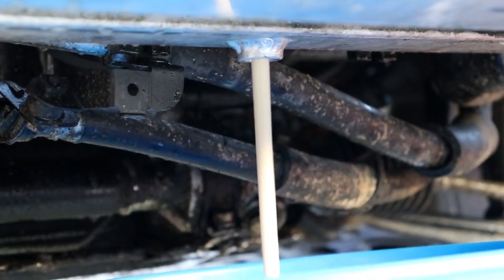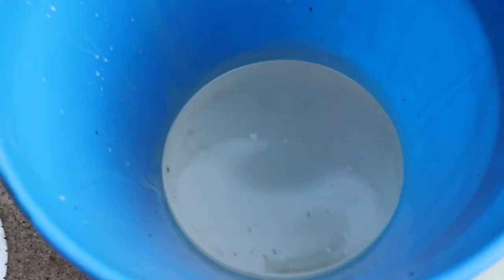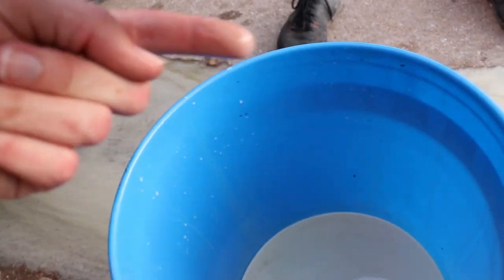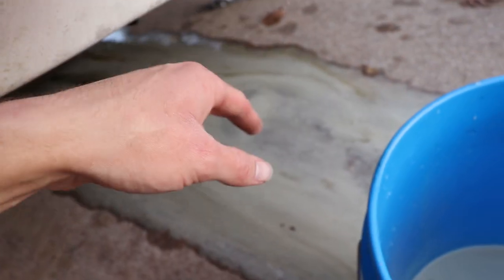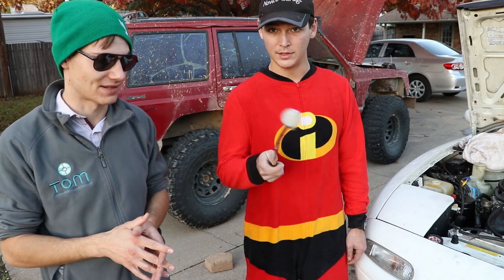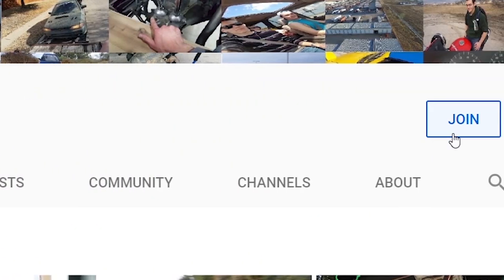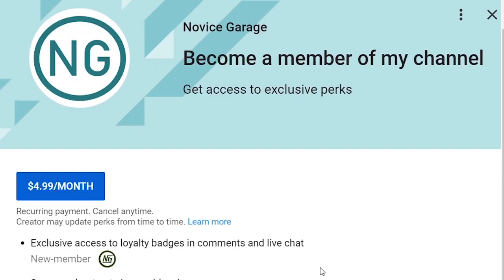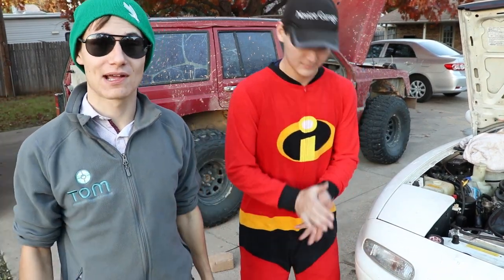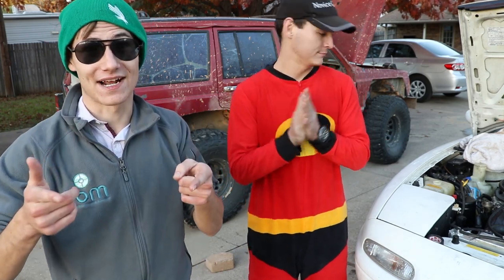It looks like a vanilla milkshake - absolutely disgusting. That's what oil looks like when used as coolant. The oil from the radiator is pretty warm, but the oil that spewed onto the ground was ice cold. So there you have it - yes, you could run engine oil as coolant, but we would not recommend running it for very long. That concludes today's episode - thank you guys for watching. We will be doing a full engine teardown of this car after all these fuel and coolant experiments. Hit subscribe and let us know what you want us to try next.